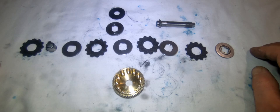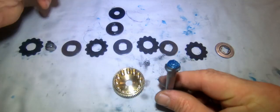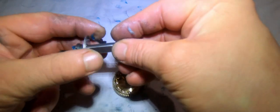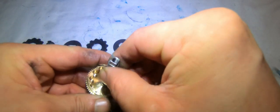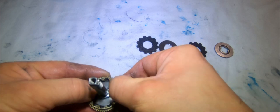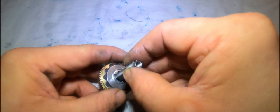There's the part order in case you get confused - that's how it goes back together. At the bottom of the arm there's a bearing that I definitely want to have grease on, so I'll put lots of grease on that. That's why we greased that hole at the top. Place the bearing on first with the clips, then the plastic washer on the back, gear on, one carbon washer, then the metal part. The first metal washer sits over there, then next carbon washer, metal washer, carbon washer, metal washer, and a carbon washer on the top cap - it sits in there like that. That's back together.